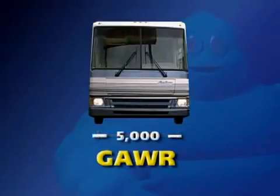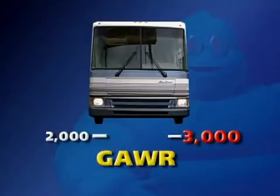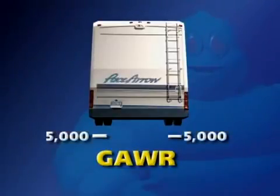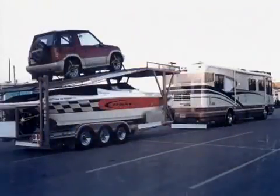If your front axle is rated at 5,000 pounds, each end of the axle can support 2,500 pounds, not 3,000 pounds on one side and 2,000 pounds on the other. If the dual axle is rated at 10,000 pounds, each end of the axle can carry up to 5,000 pounds. The GVW is the maximum a vehicle can weigh fully loaded with passengers, cargo, and liquids.